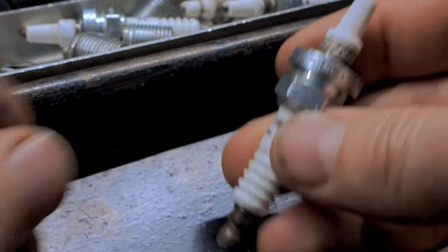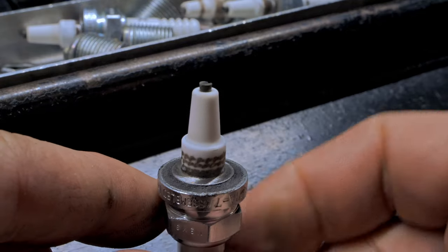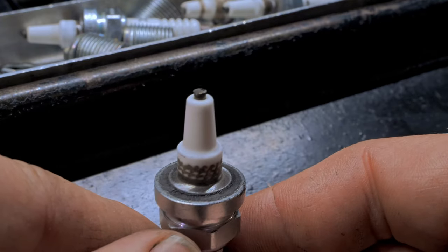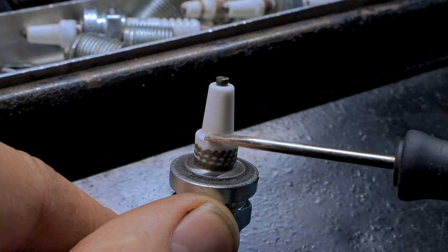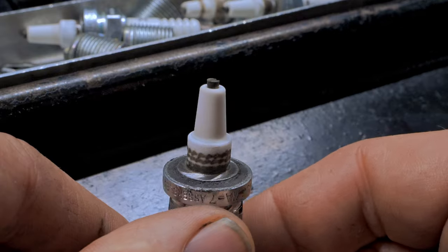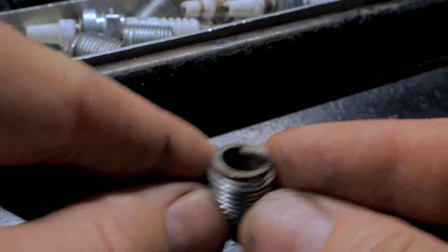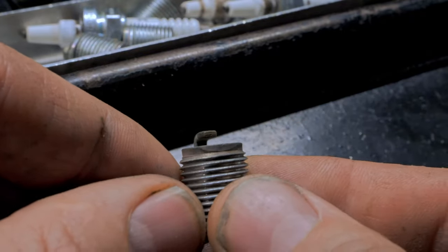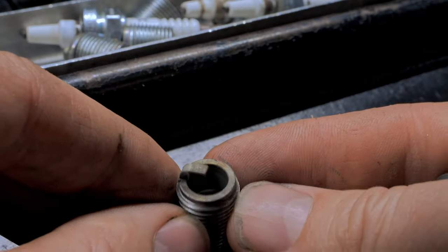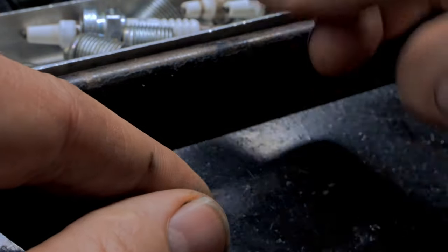Five. Here's five. This fuel ring might be slightly easier to see. I can see it pretty well off camera. Hopefully you guys can see it, but you can see the difference as it goes up. See that? Timing mark, exact same spot. Heat: oh, look, we barely touched that thread right there on this one. So we had a little more heat in that one. I'll better keep an eye on number five when we start spraying nitrous.